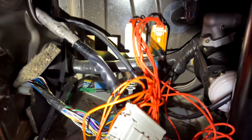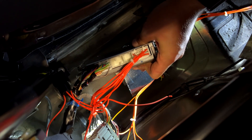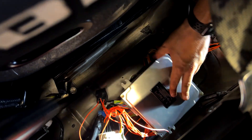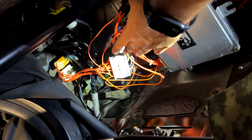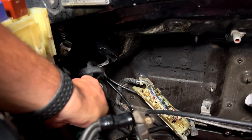A few more things are plugged in over there in the back. It's a bit messy but I'm going to tidy it all up after. This is essentially the mixture between the adapter harness and the directly plugging-in harness from the engine bay. We also have some extra plugs for additional sensors and the USB plug we'll use with the computer to access the ECU. There's also an extra ground wire. In the end, the engine harness is more than long enough to reach into the car.